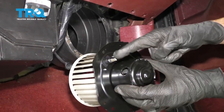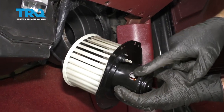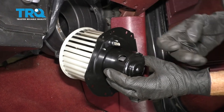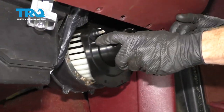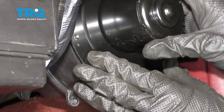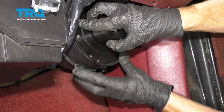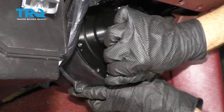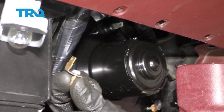When installing the new blower motor, make sure the wire is facing up. This is also the area where the little rubber tube leads from, which was also up — that makes it easier to remember orientation. Lift up on the dash, gently slide the blower motor in, paying attention to your alignment tabs. Slide it in so it lines up with each of the tabs, then start in all of your mounting bolts. Make sure you put the ground terminal exactly back where you got it from. Once all bolts are started, snug them all up.